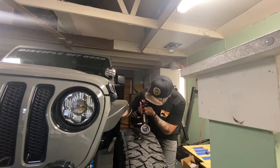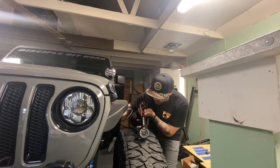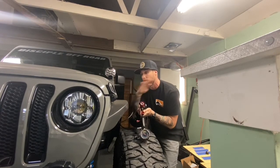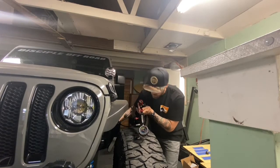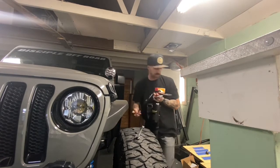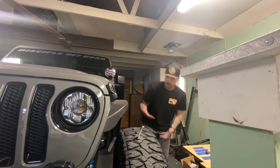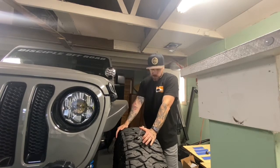Now that we've done that and closed the nitrogen off, we're going to release the pressure on the Schrader valve — basically open it back up so it's now sealing itself. The Schrader valve comes back up and the shock is closed for business. We won't be able to put anything in or take anything out unless we press it again. Now I'm going to release the tank — you'll probably hear a little of what's in the line come out. There's the nitrogen pressure release. And that's it. The hydraulic bump is charged. We'll remove the chuck, and now I have matching hydraulic bump pressures.